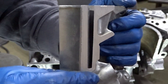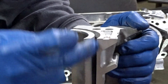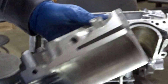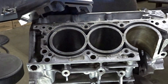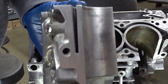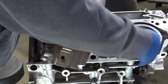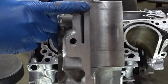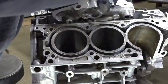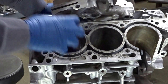You can see how this has a very small taper to it, possibly getting a little bit thicker lower down. What you can do — it's kind of like a concrete material — is tip the block up on its side, block the water port passages in the front, and then fill the open deck area with block fill. You can fill the block interior up to just an inch from the top in some cases, or only about halfway up in others. We're going to experiment with the second block we're building, filling the cylinders a bit with block fill to add rigidity to the block and hopefully to the liners themselves.